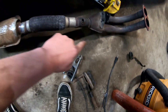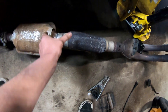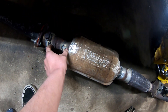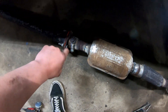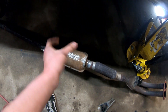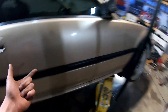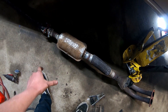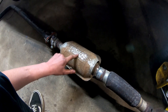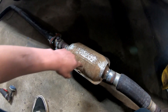This is the final exhaust. I've got to put the O2 back in, but it goes into the flex pipe that I already had, to a little adapter. Then it goes to the cat which is inside there — a little adapter off of a CRV exhaust, this piece which came off the resonator, and then the gasket with some high-temp silicone, and the rest of the cat-back. This hopefully won't make it too much quieter or take away too much power — not that this car makes power to begin with. But I'm thinking it should make it stop smelling and smoking as much as it does now. The Accord when it had no cat steamed a lot. I mean this thing burns oil, but it shouldn't look like it's burning nearly as much as it does now.